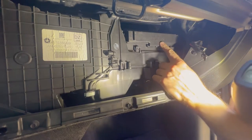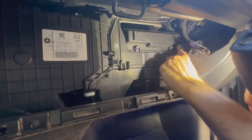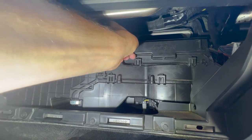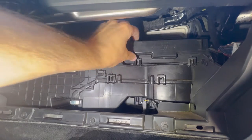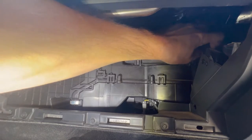Now peek down where we removed the glove box. You can see on the right side there is a cover — this cover says 'Airflow' with an arrow pointing down, which is good design. You should be able to release this cover by pressing on both sides; the left and right side each have a clip that holds it in. Once you press on both sides it should release and that cover should come off.